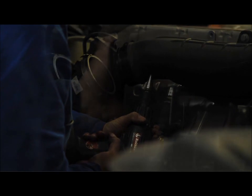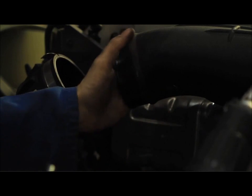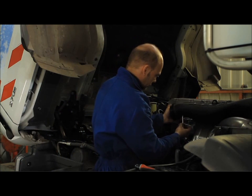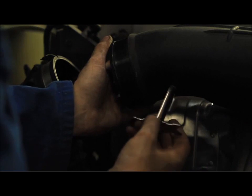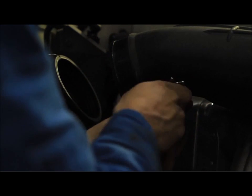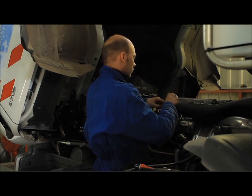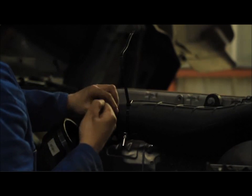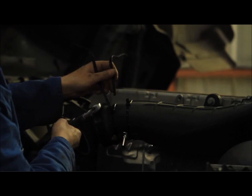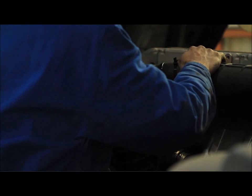Drill a 16mm hole with a normal or multi-staged bit. Insert the diffuser with force, being sure to orient the arrow on the diffuser in the same direction as the air circulation. Fix the diffuser in place with the plastic collars furnished. Refit the hose in place.